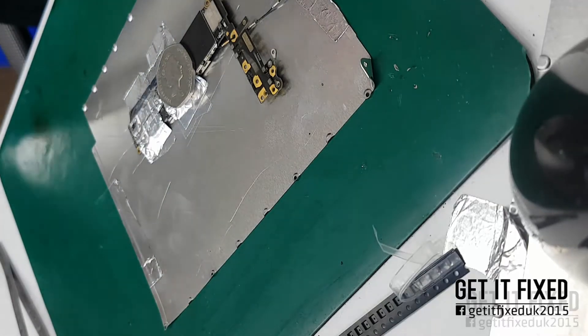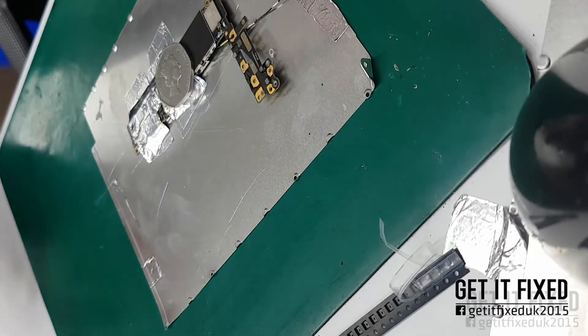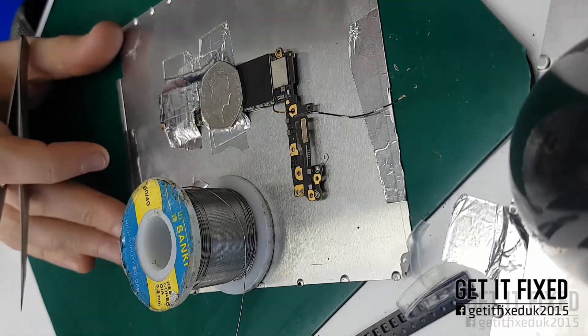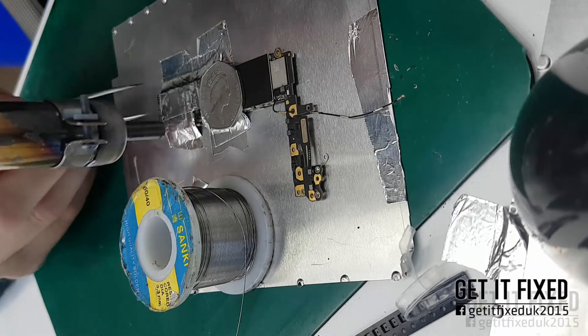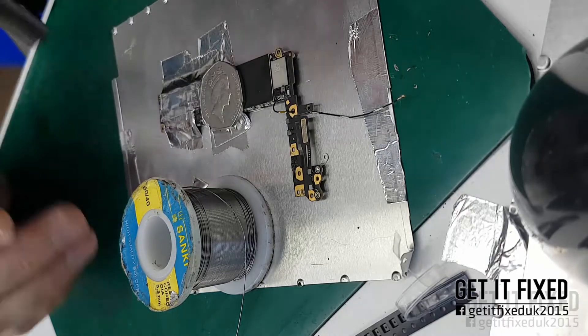This video is just about how to replace the charging IC. It's quite easy if you have experience changing other kinds of chips — it should be straightforward. Clean off whatever silicone is on top, remove the chip, clean the pads, put it back, and make sure you align it properly. Use a small microscope to verify alignment.